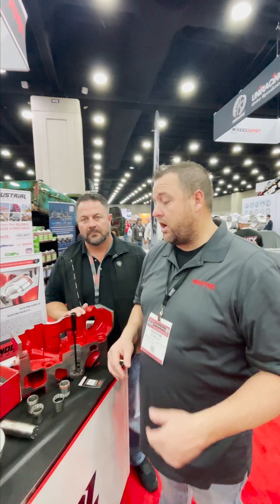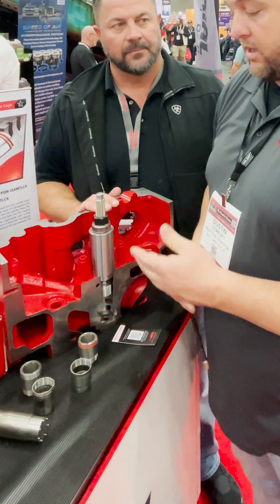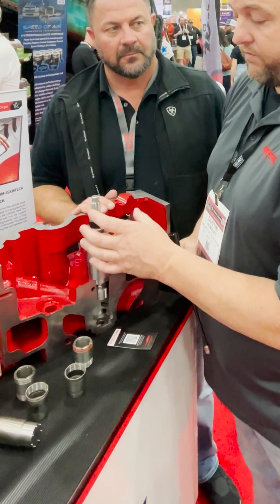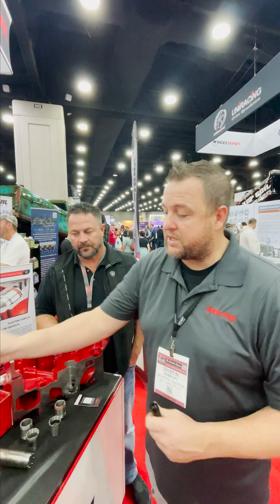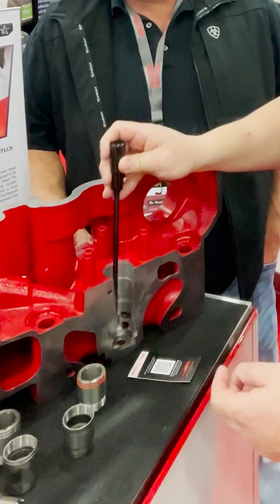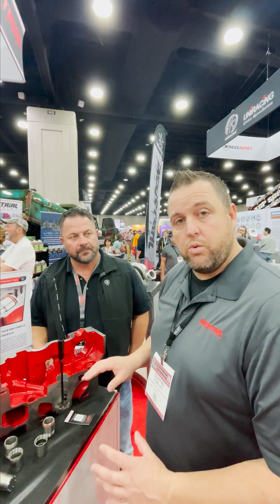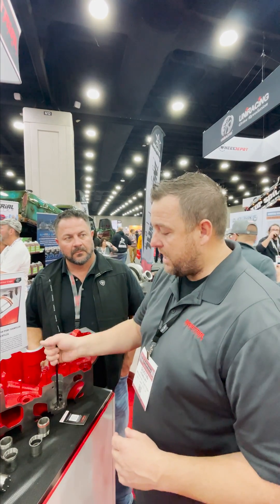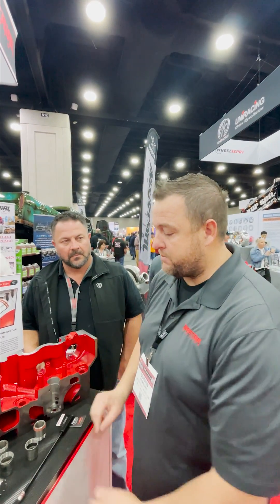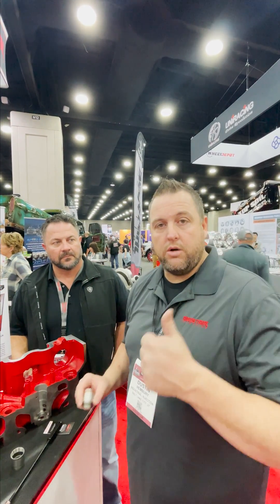You don't have to take the cylinder head off. The cup holder will actually fit between the springs and the exhaust valves and the intake valves. It'll fit between the springs and you can pull the stock cups out. It comes with all the taps you need. It even comes with a cool little plug that you can put down into the injector hole and you can do all the work in the truck — vacuum it out, pop that back out, put your injectors back in. Now you have Billet Torque Lock injector cups installed. They'll never leak. You're good to go.